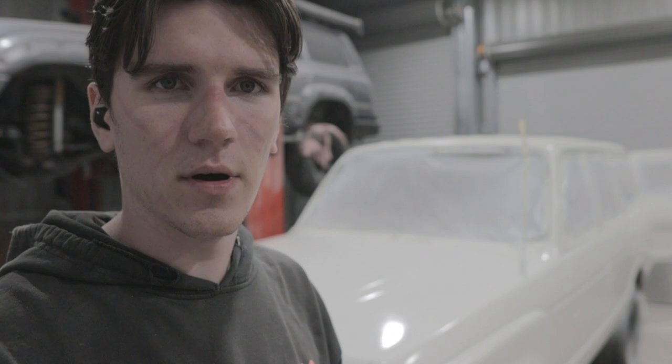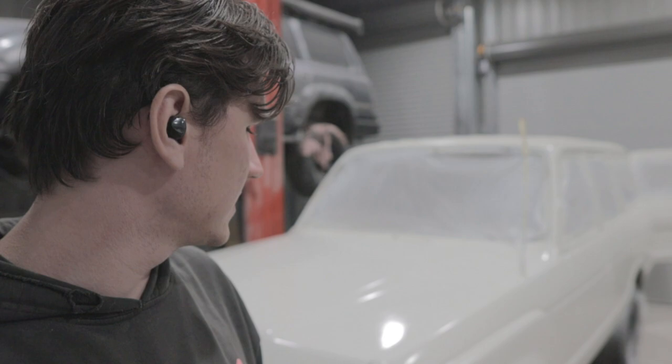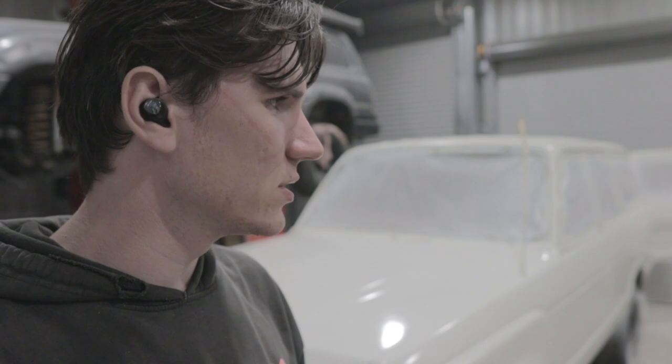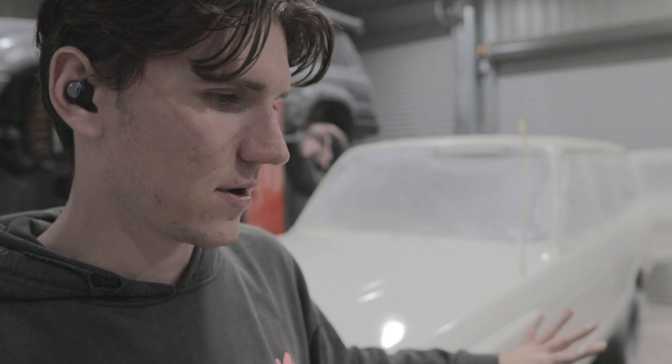I had a few learning things, like the masking tape, that all of the sheets there has dried primer on it, and that primer flakes off and gets onto the paint. It wasn't really all that bad because I was actively spraying and it was flying away, and then it would get caught on the water on the ground. That's why you put the water on the ground, so that sort of stuff goes and sits on the ground.